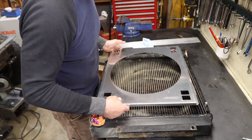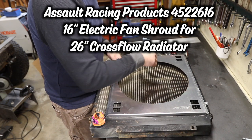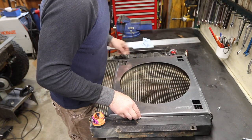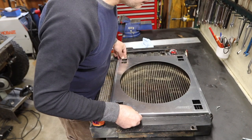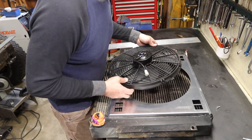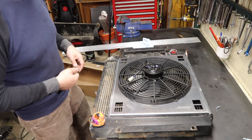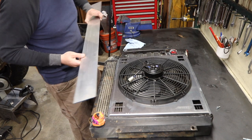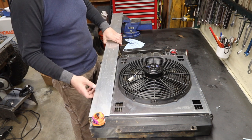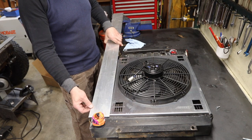I got this shroud from a company — I'll put a link or at least a model number in the description of the video. I'm going to mount it this way on the Scout. These are quarter-20 bolt mounts, and it's basically a perfect fit on the Scout radiator. There's a gap, so all I've done is gotten some four-inch aluminum stock that I'll cut to size — it'll sit over here and bolt onto this flange. This flange will bolt in the stock Scout locations and this will bolt to the Scout radiator down here.